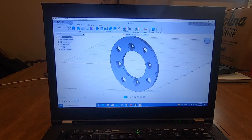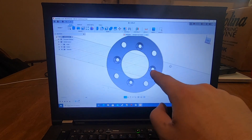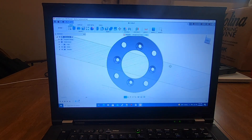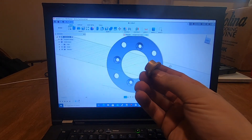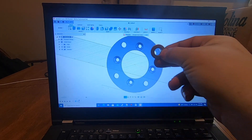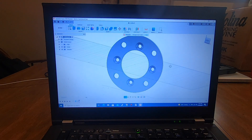Here's this simple little fixture — it looks just like a wheel spacer. Essentially, this inner pattern bolts to the wheel hub the way it is, and then this outer pattern has the bore size of this bushing. I'm going to step around, plug the bushing in, drill the hole, move it, and work my way around like that. Everything should be nice and true, and the wheel should run great.